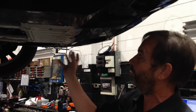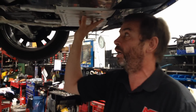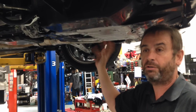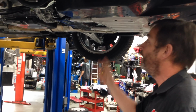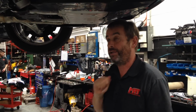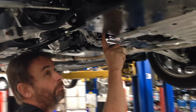But let's talk about the engine configuration. Again, like the WRX, you've got a twin scroll turbo up inside here, and I've taken some still photos so you can have a look at the bottom of this video to see what it's like. The 2-litre direct injection engine, this model now from 2013 onwards, which first came out in Australia in the Subaru Forester XT, has the turbo underneath, built into the exhaust manifold. Fantastic turbo, comes on boost very early. Check out our other video on how you can make it go a little bit better. The car comes factory standard with electric power steering. And as we were saying earlier, you can only get this model with the CVT transmission.